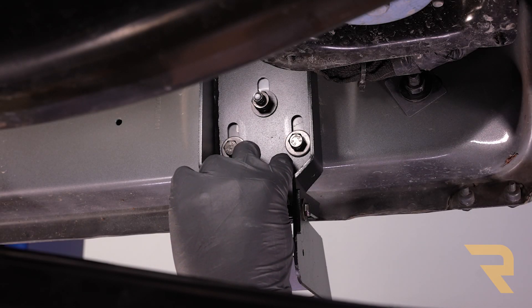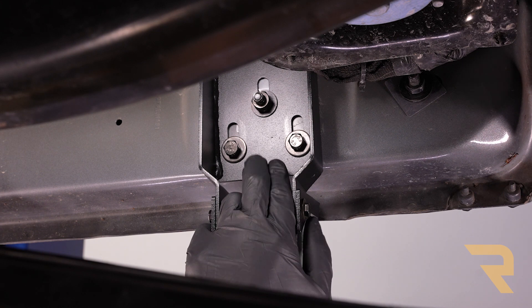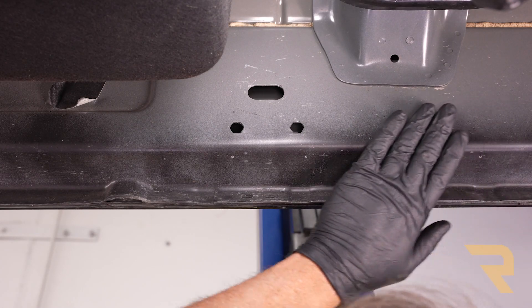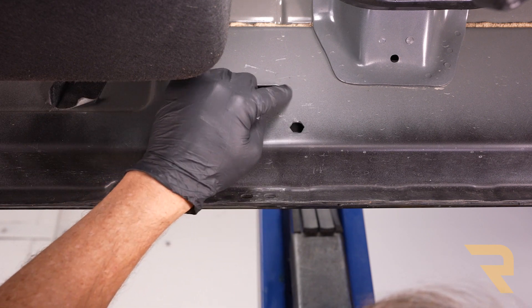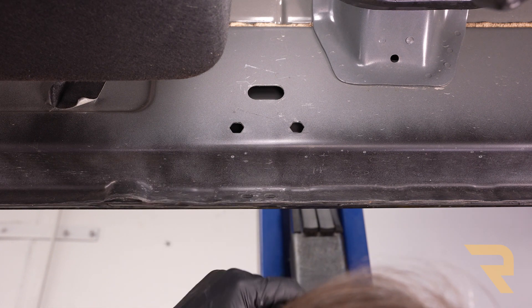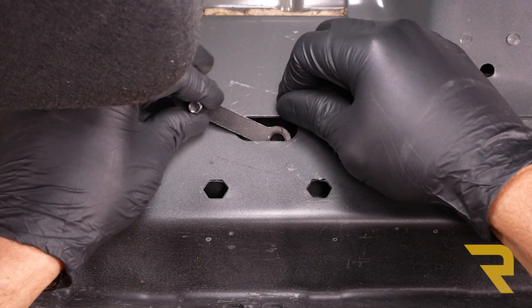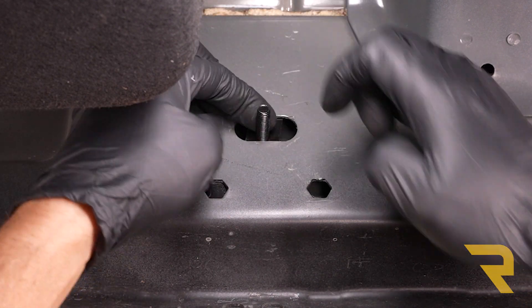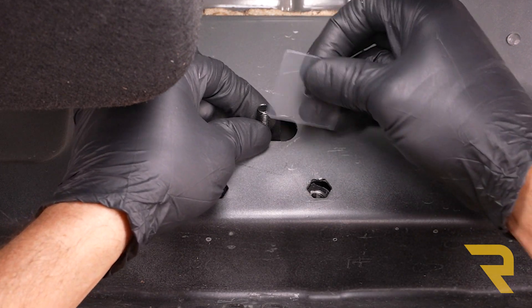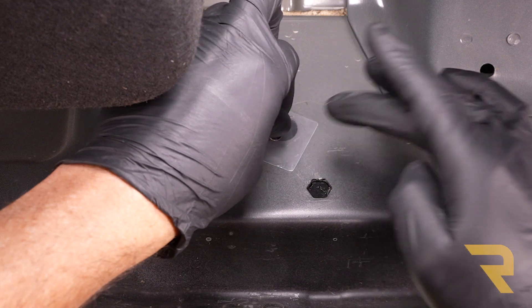So if you've got threaded holes at the bottom on each one of your bracket locations, just repeat the exact same process on each bracket. We have our center bracket that has open holes, so I'm going to show you how to do that next. And we're going to repeat our same process on our rear bracket because that's what our setup has. Now as you move along the rocker panel, you're going to come across another couple of holes with an oval hole up top. These do not have the threads behind there. So this is our second bracket location. This is our triangular bolt plate with welded nuts. What this is going to do is it's going to kind of turn upside down, slip into the rocker panel like so, and then fish back around. Once that's in place, we'll be able to see how we can line up the holes that are threaded back behind our rocker panel. And we're going to take our plastic retainer washer and put that onto our bolt plate so the bolt plate doesn't slip back into the rocker panel while we're installing the bracket.